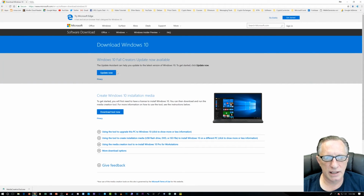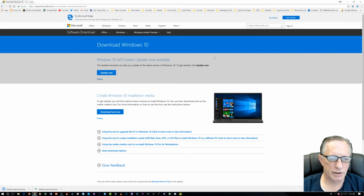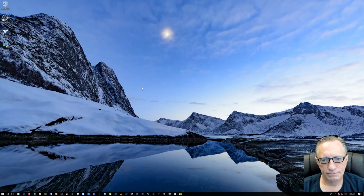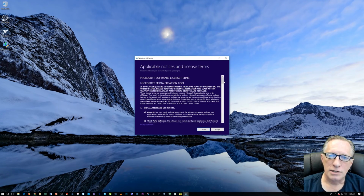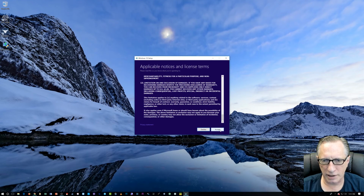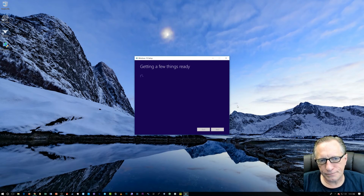Okay, in order to create a cold storage wallet, we're going to want to install Windows on a new machine that will not ever connect to the internet. We can use an old laptop that might be laying around. We can put a new hard drive in an existing laptop, swap out, or add a secondary hard drive to a desktop machine. And you can choose in the BIOS which drive to boot from, disconnect your network cable, and boot up that machine. The idea is that we want to install Windows clean on a machine that has never been connected to the internet. And how you go about it is up to you.